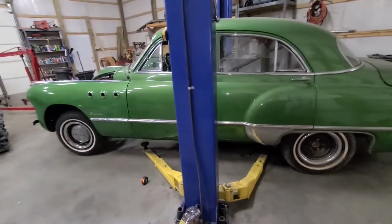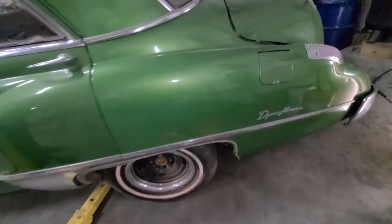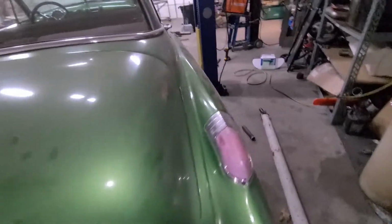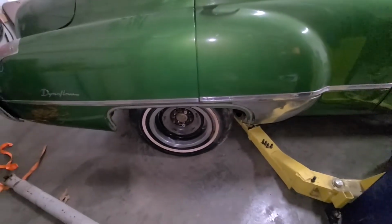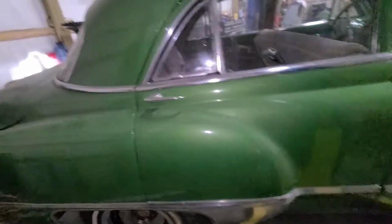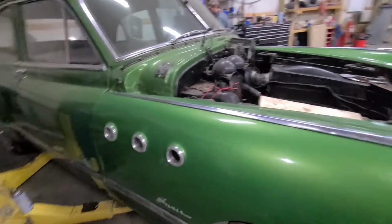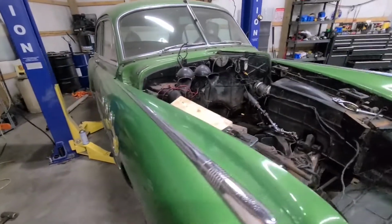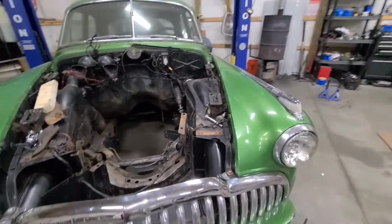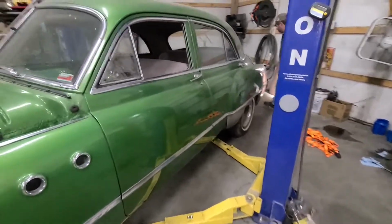Okay, the back of the car is sitting on its own weight. It looks like we got the rear end pretty much square in the car. We have a little bit of adjustability to push it forward and back because of those threaded ends. So that's going to do it for this video, because this video is going to be pretty long, I think. The only thing that's not hooked up in the rear end is a panhard bar, which we'll probably have to modify to make sure that that's centered. Next video we'll be working on probably brakes, and we'll also be finishing up the rear suspension.